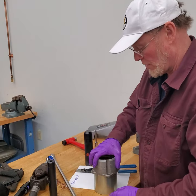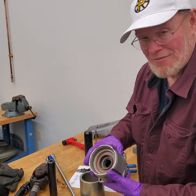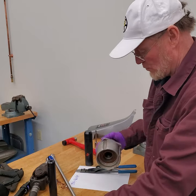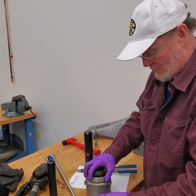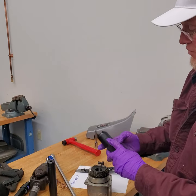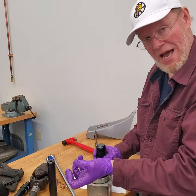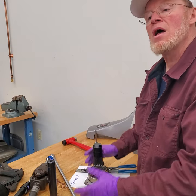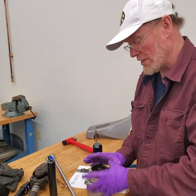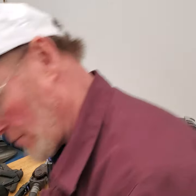Once that's done, pull the gear out and take this fixture. What's left is the bearing inside and the seal. I'm going to flip this over — I don't need the first tool anymore. Put this on the press with room for the seal to come out. I'll take the 884-263 tool and press the bearing and the seal out. Then I'll go through the reassembly and setup procedure next. We'll put a new seal in when we're all done, and we're going to set the preload — bearing preload, or as I call it, the rolling torque of the two bearings.